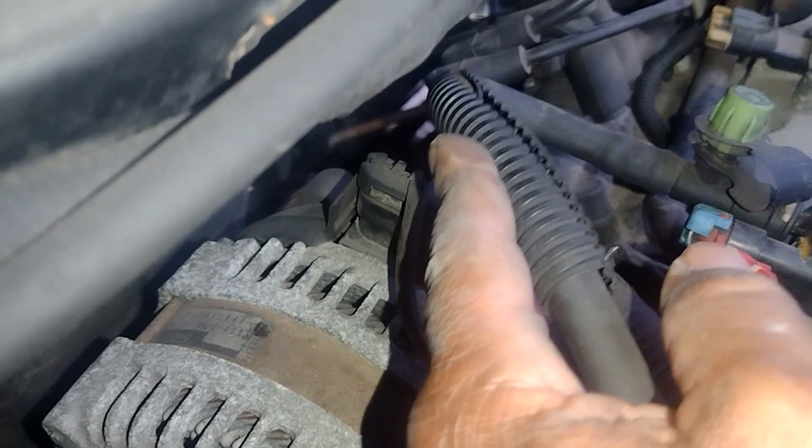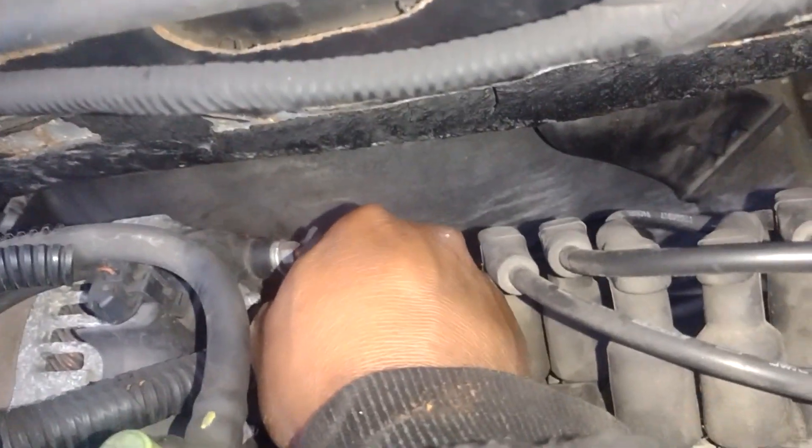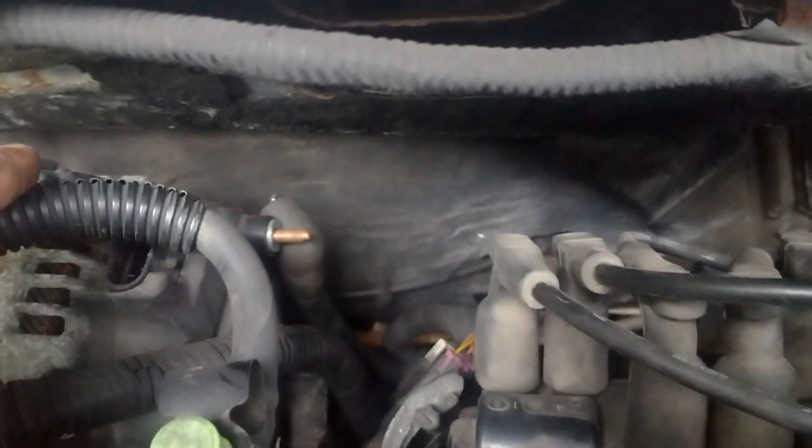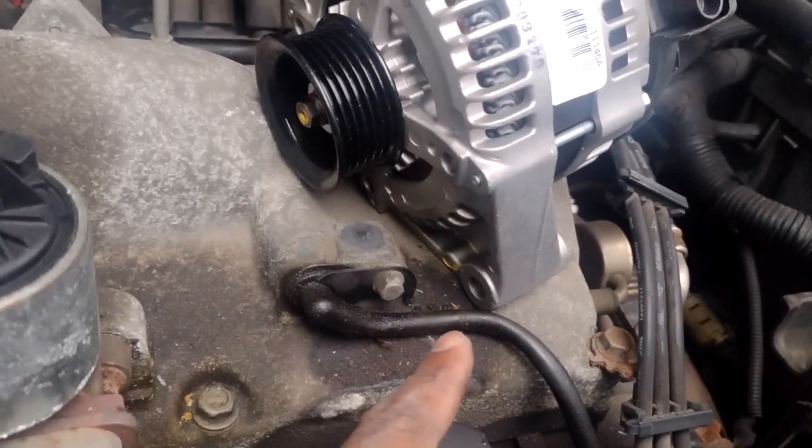Right on top is a plug. Let's get some light — disconnect that plug, pull that boot back, and take that nut off. I don't know what size it is, but let's get those two parts off. I got the electrical plug out and the connector. Mine was a 10mm nut. For the electrical connector, you just push or lift up the tab and pull it out. You got one bolt here on the side, down at the bottom, and in the back.